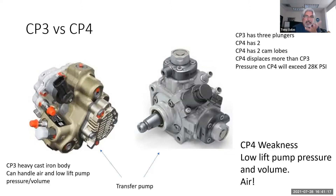They're saying it mostly occurs at service — and that is so true. I've visited shops and asked questions. You're doing the fuel filter service all wrong. Even read the Ford service procedure: they tell you to put the filters in, and when you're done, you're supposed to prime the pump. Once you do several key cycles or run it with your scan tool, start the truck and let it idle for at least 10 minutes, letting it work its air out.